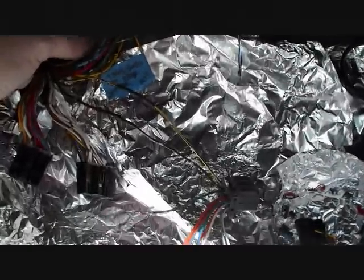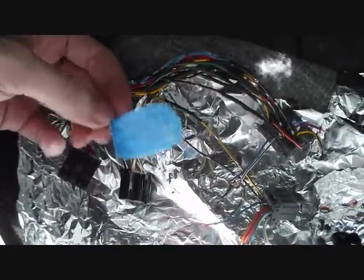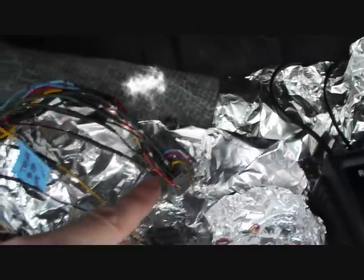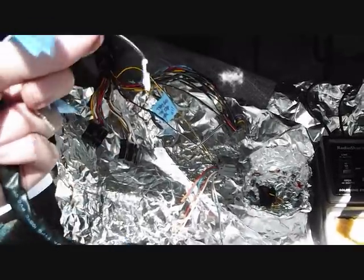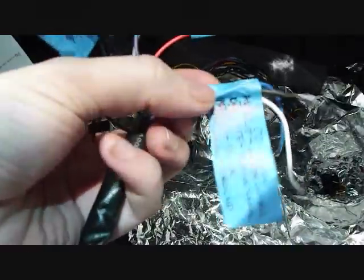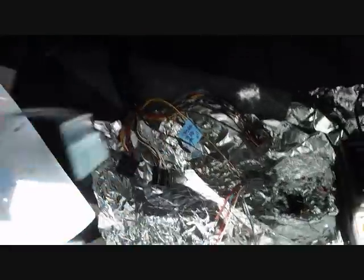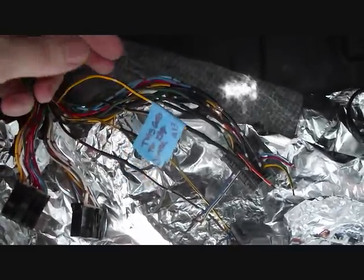I haven't had any real problems. The only thing I messed up on was I actually cut one of the wires too short on the OBD1 clip, so I have to re-splice that with another wire. I found an extra wire because I kept some of my wires with the extra pins from when I pulled them out, sorted by size. Turns out the clip already fit on a wire from the old jumper harness, so I don't need to do anything extra — it's already spliced. I taped it up so I don't lose it, and left myself a reminder so I know where that one goes.